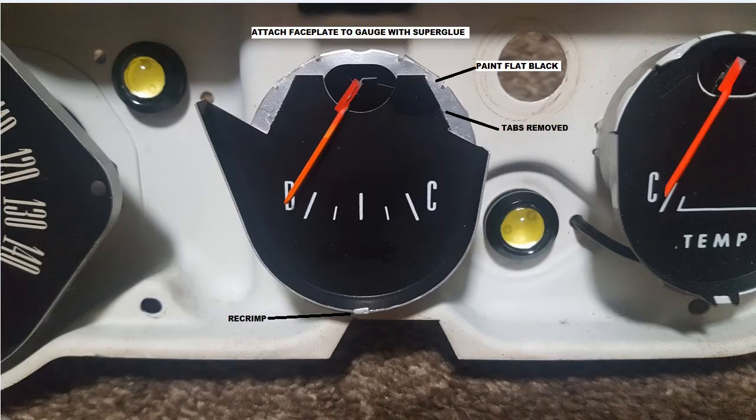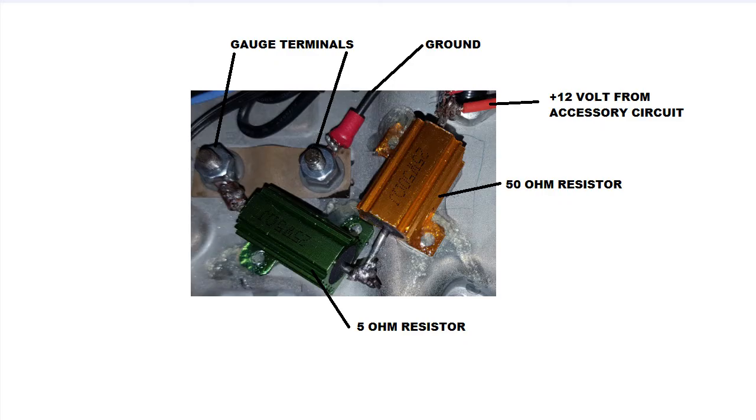The wiring was very simple, needing 55 ohms to reduce the 12 volts to what was needed to put the needle to the center hash mark at 12 to 12.6 volts. Since a 25 watt 55 ohm resistor was not readily available, I used a 50 ohm and a 5 ohm in series. Amazon links for the resistors and transfer letters are included in the description.